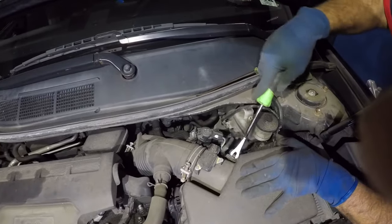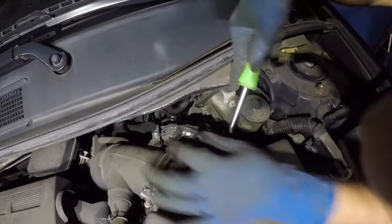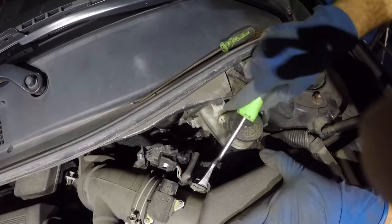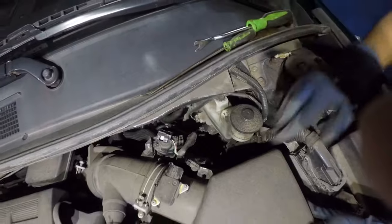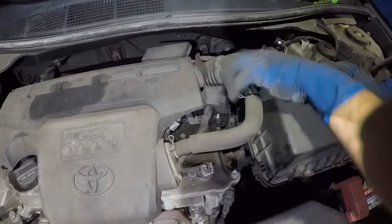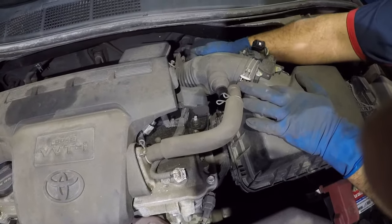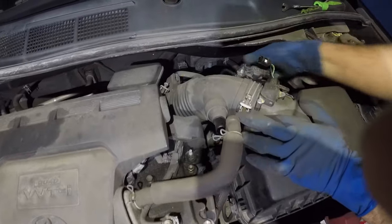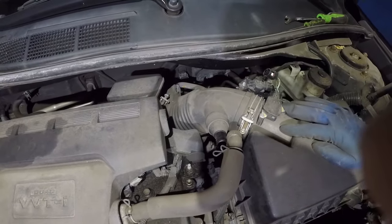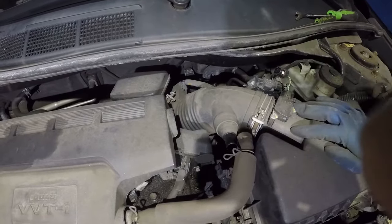The sensor can stay with the whole duct pipe. You also have a little clip right here, so you're gonna need a tool such as this fork to remove this little guy from the housing. After that, take this off and this hose comes off. Then you got this vacuum pipe here — just push it out of the tab. Down on the neck of this air duct pipe, we're gonna take off the clamp with a number 10. I'm gonna loosen it and once I have it out I'll show you.